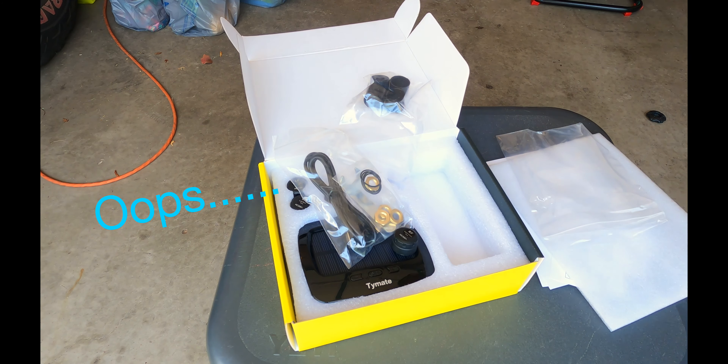Put it on — it's on there good and tight. Now take that hex nut and spin it up against your sensor to keep it locked in place. Then take your dust cover and flip it back up for a little added extra protection. I'm going to do the other three and we'll take the road trip and hope it works out.